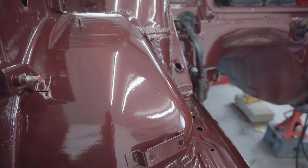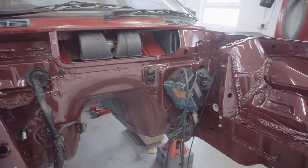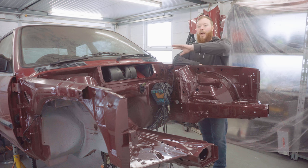I'm pleased to report that the new ANI spray gun is a roaring success. The way it atomises the paint with such a large spray pattern, with a large fan, is really great, and I think it'll be a game changer when I spray the exterior of the car, far better than using that Sealey gun. Now, when you're painting clear coat, what you need to do really is lead a wet edge around,